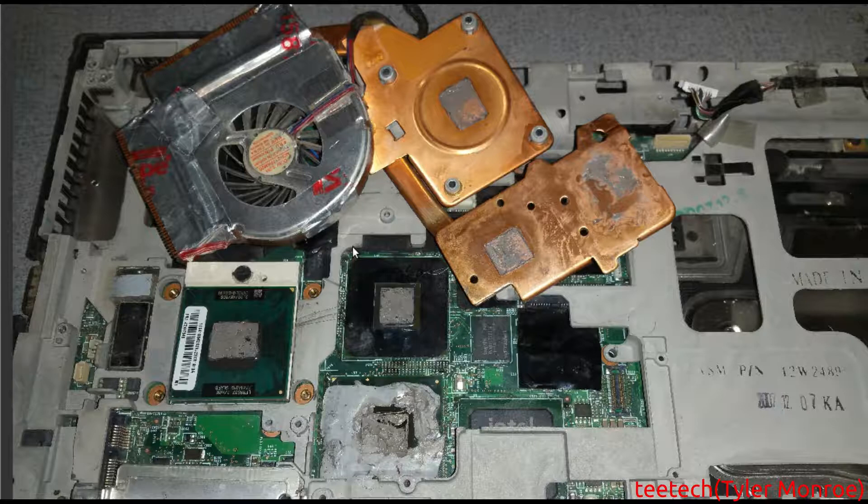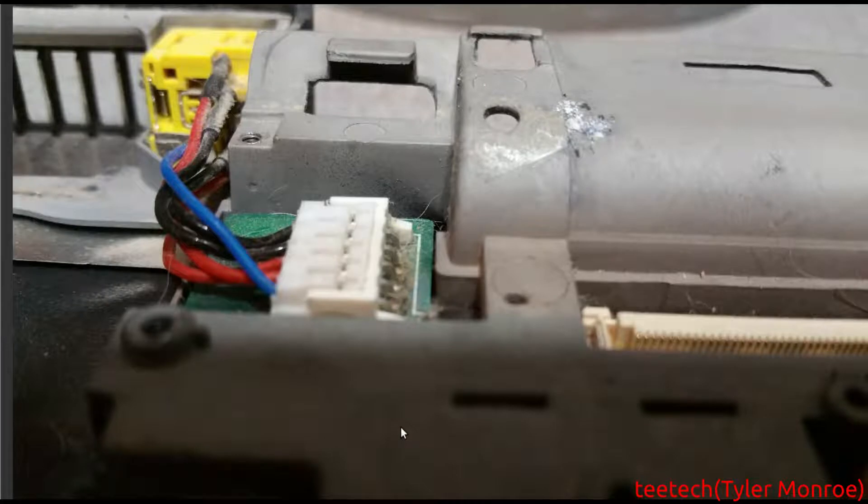I will add this had prior work done before I had gotten it, so this isn't probably how your fan will look if you're still using this model of ThinkPad. An important thing: you want to clean these off with rubbing alcohol and clean off all the old thermal paste, and clean the thermal paste off the CPU. You don't have to worry about the GPU because that is soldered to the board. One chip has not thermal paste all the way around it but actually a thermal pad — I took an X-Acto knife carefully and cut around the edge to get that out.